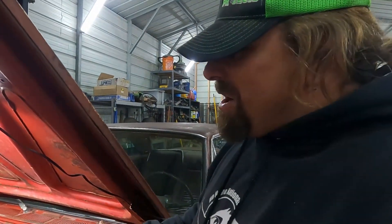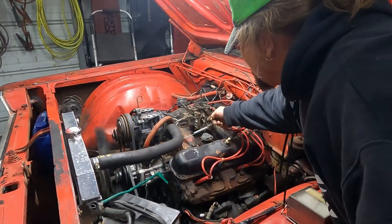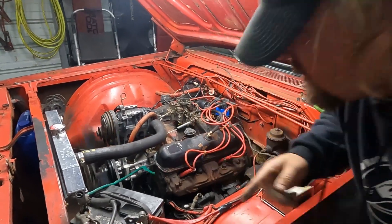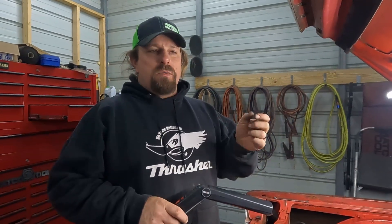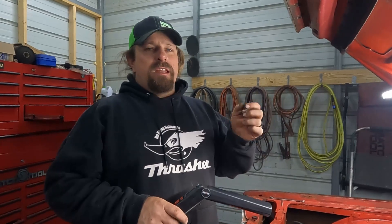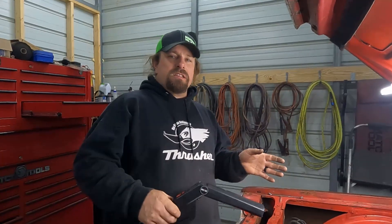With the car running we've highlighted another problem — the carburetor doesn't come back to idle for some reason, and it's running at almost 1,800 RPM. The tenth and final check is setting the timing. We're doing this last because everything can affect the timing — if you set the dwell after setting the timing you'll change the timing, because changing the dwell effectively changes the gap in the points and the opening time. So this is the last step in getting our ignition system all tuned up.